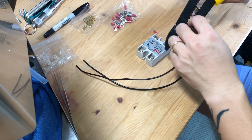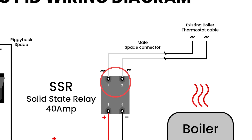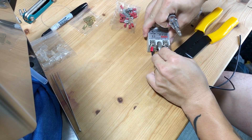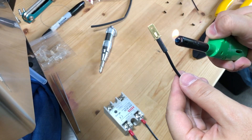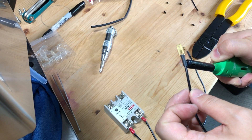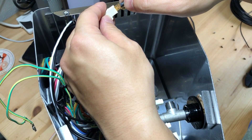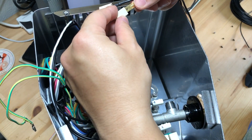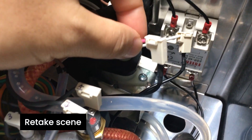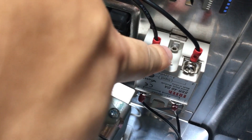Let's prepare the wiring for the solid state relay and connect them to numbers 1 and 2 on the relay. Make two wires about one foot each in length. These wires will be connected to the existing temperature wires that were originally made for the thermostat. Connect two male spade connectors to the existing thermostat wires. These wires are neutral wires so it doesn't matter which way you connect them. You can see a brief overview of how everything is connected inside the Gaggia Classic. I mounted the relay upside down and had to drill a tiny hole for a screw to hold the relay in place.